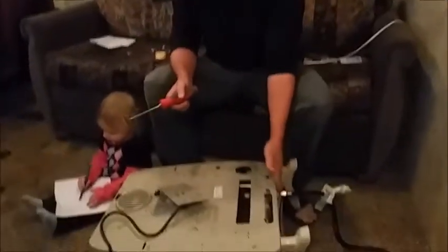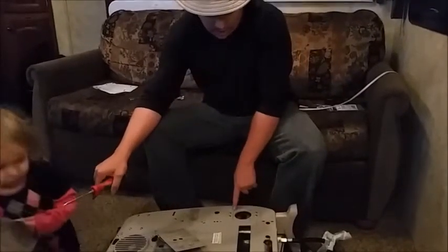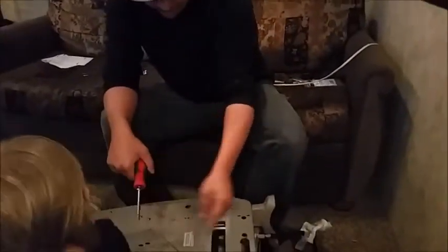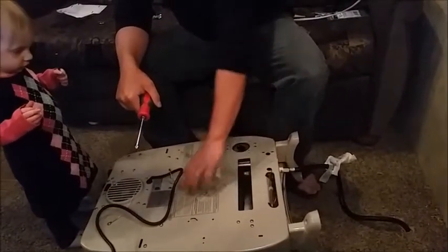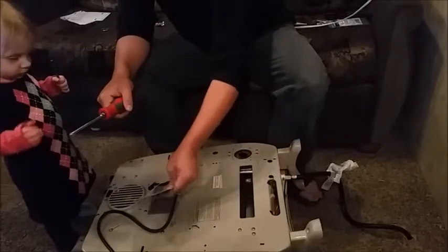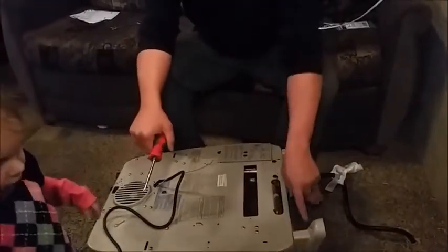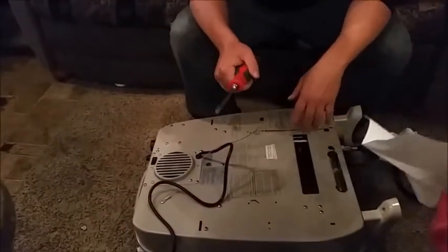The gas line is hooked up and run to the floor. What you need to do last is make sure you're set to LP, because I'm running on liquid propane — right here. You take the cover off and it's just something you can turn, so I've got it set to liquid propane, then replace the cover. Then you want to bolt it to the floor — there are two little holes in each foot, and you're just gonna bolt that to the floor to keep it from falling over.